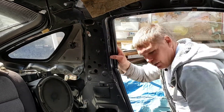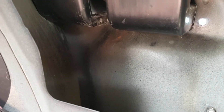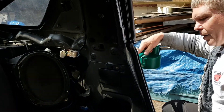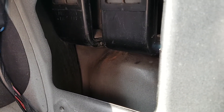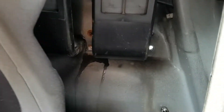If we come down here, under here you can see all sorts of run marks where water has run down the inside wall. This is a really common one, and what I'm going to do now is just pour some water down the body of the car so you can see where it's coming in. And there we can see it — water pouring in right there.